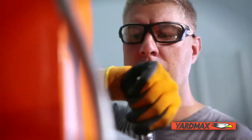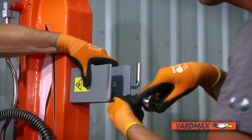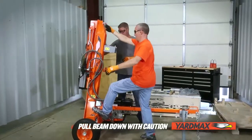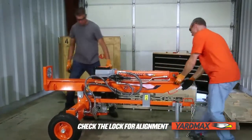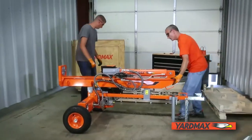When complete, you are now ready to move the beam to the horizontal position and complete the final steps of assembly. Slowly pull on the beam handle, controlling its weight until everything aligns. Double check that the beam bracket has locked onto the beam. Never drop the beam onto the tow bar, and ensure you keep hands and fingers clear of all pinch and pivot points.